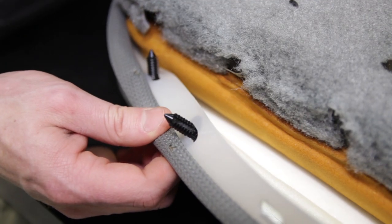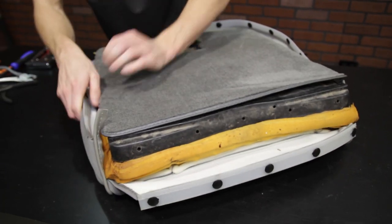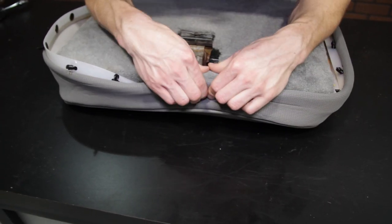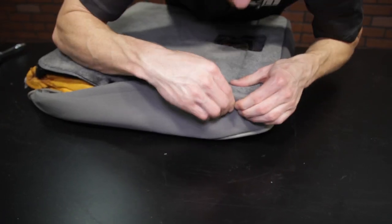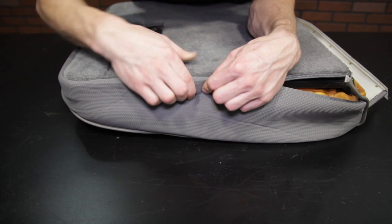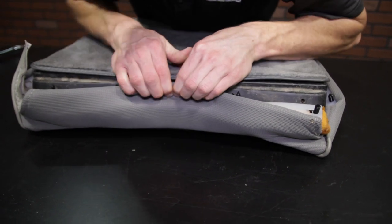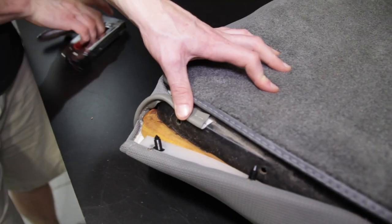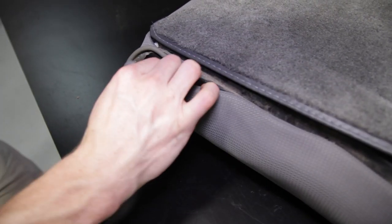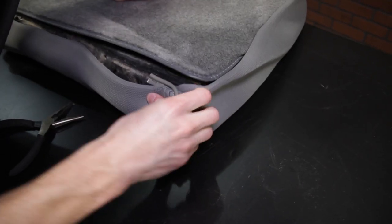Position the provided clips into the sheathing on the upholstery. Pull the upholstery tight and then roll it over the foam. Roll the plastic sheathing toward the seat back and begin pushing them all into place. Work your way across the top and then the two sides. Move to the bottom and secure just the center clip — on each side of the sheath the very bottom clip provisions do not need a clip. Grab the piping and pull firmly, position it on the flat spot located on the seat back, apply firm pressure with your staple gun and attach three staples. Clip the remaining clips on that side, then do the same for the other side on the bottom of the seat back and secure the remaining clips.